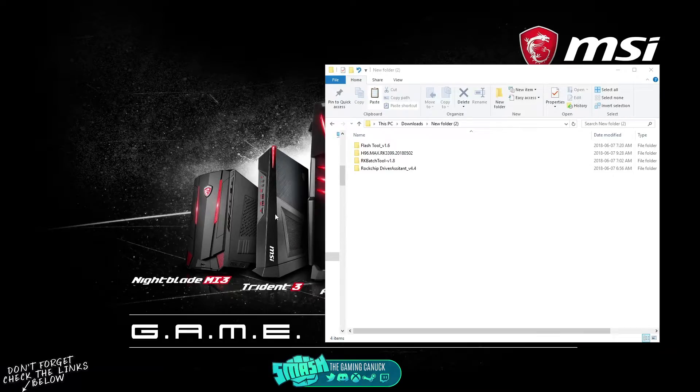Now that you understand you need the device, the firmware — stock or custom — your toothpick or object to activate the reset in the AV port, and your double-ended USB cable. Depending on the device you'll need specific drivers: for Rockchip boxes you need the Rockchip driver set; other boxes like the T95Z use a USB Burning Tool. All these tools are pretty much laid out the same — some will be in English, some won't — but they all work similarly.